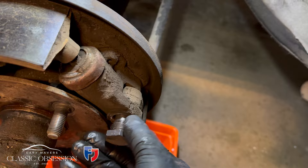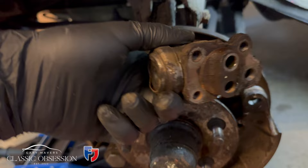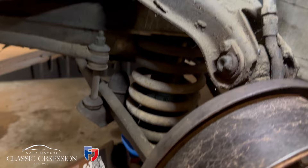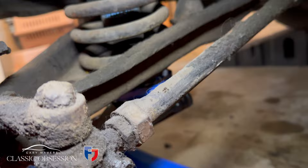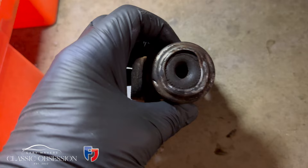Undo the lock tabs and out with the bolt. Out with the bleed nipple and then out with the cylinder. There is an easier way of doing this with better access and that's to remove the hub, but I'm doing this one the lazy way. All these suspension components like the wishbones and everything else will all have to be scraped off of grease and oil, cleaned up, and all the grease nipples filled with fresh grease. And all these flexi hoses will have to be replaced — these clog up like arteries.